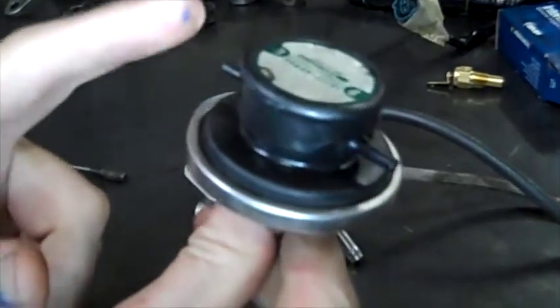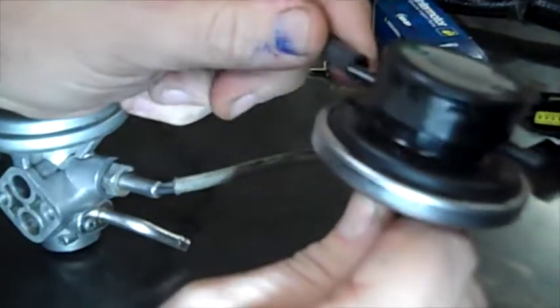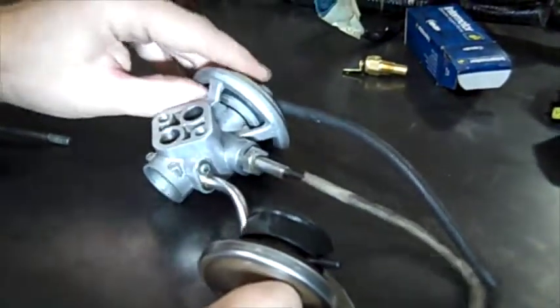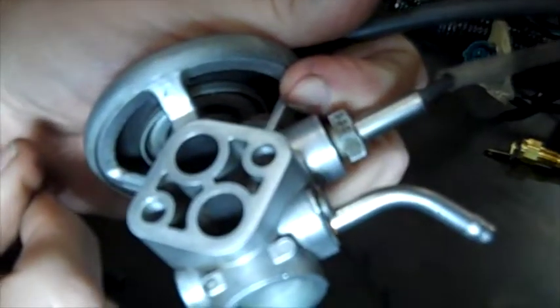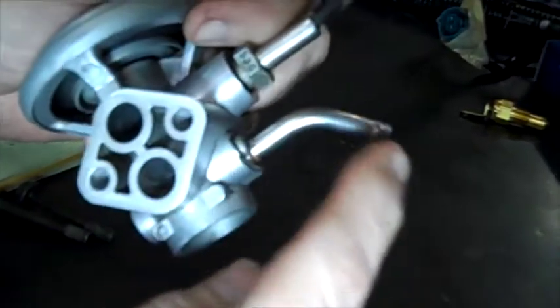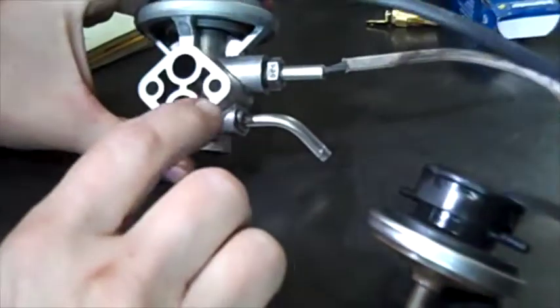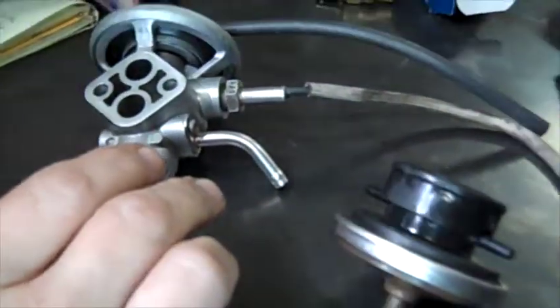Either side goes from here to the top of the EGR valve. So if you get a vacuum, that causes this valve to open. So if you have a lot of exhaust pressure then this valve opens. If it's hooked up to the car and the engine is idling and you reach over and push this valve up, your engine idle should slow down or even stall out. If you reach over and push this up and nothing happens, that means your exhaust port is blocked somewhere. In some situations, if your engine is cold for example, you don't want exhaust to go into your intake manifold even if you do have exhaust pressure, so the engine needs a way to shut that off.